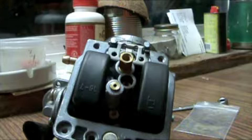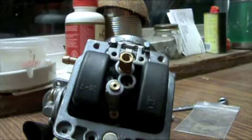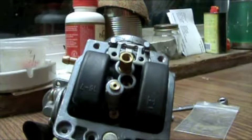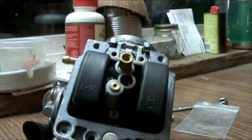I haven't put any aftermarket exhaust on and I don't want to lose too much fuel economy, but I'm going to kind of experiment with this. It is a pain to switch the carburetor jet — taking the carburetor off was kind of a pain. There's not a whole lot of difference in these. I've heard good results from people switching to like a 115 or 120 on the forum and other places online. So I'm going to switch to the 125. I cleaned my spark plug off and it looks to me like it's still running lean, especially after the air intake. I want to see what the 125 is going to do.